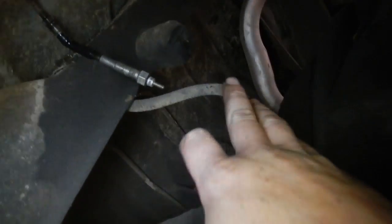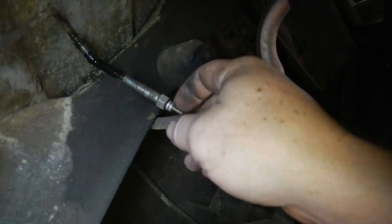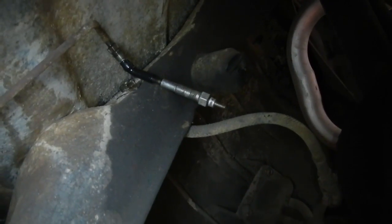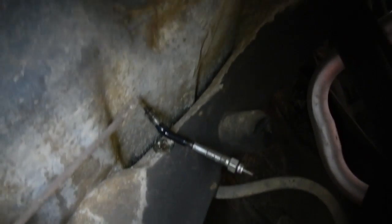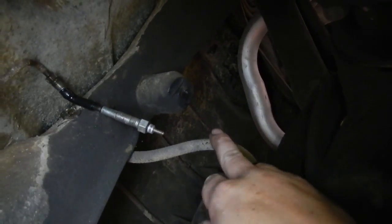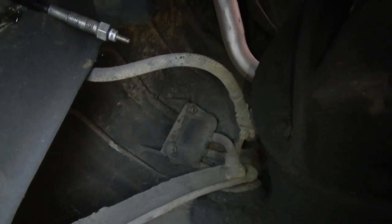First I'm going to take off this brake line, because that's original and very crusty. If you're wondering what that is, it's just a glow plug shoved into some vacuum line and it makes a wonderful brake line stopper basically. You slide it on and no fluid comes out. This hose is rooted, so I'll get that off, which is going to be a bit of a prick, but oh well.